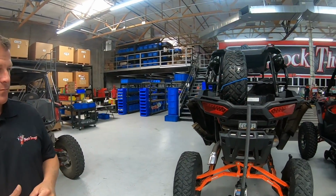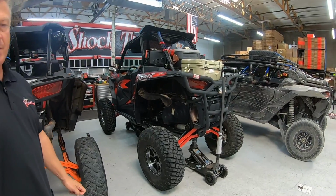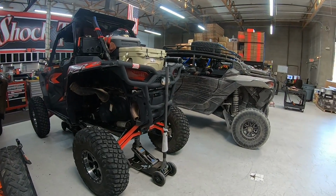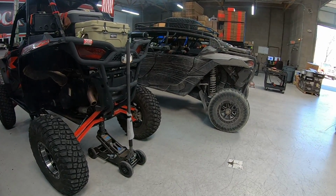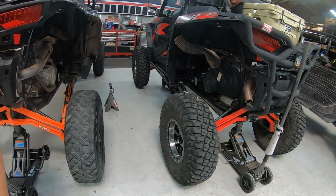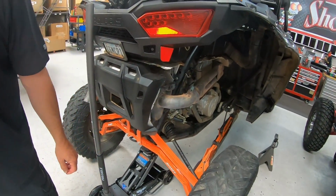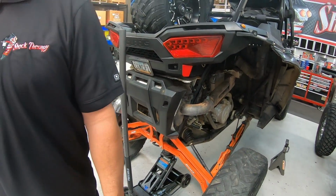You're fine. Alex Seed says, what's the offset mean if it only says 13 millimeter? 13 millimeter, back to the drawing on the board earlier, plus 13 would mean that it's a 4.3. So bad for anything on the front. If it said plus 38 or plus 36 in that range, that would be a 5.2.